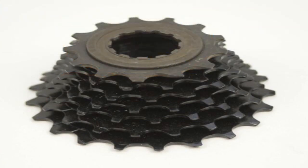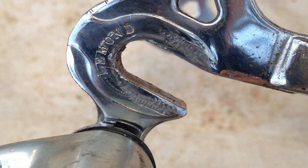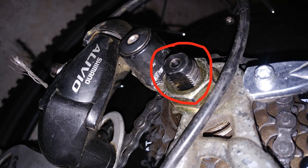The first thing you want to do is thread the 7-sprocket cassette onto the hub. You don't need a tool here because just pedaling the bike will tighten it. Then put on the inner tube and tire, and you're ready to swap out the wheel. The axle dropouts on my GT were slotted, and the new hub's axle was flattened. So it slipped in perfectly, and because the axle is flattened it can't rotate in the frame even under full power.